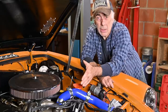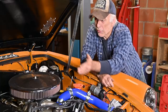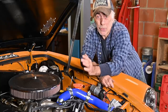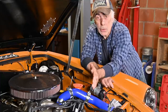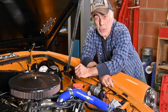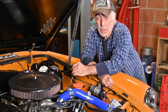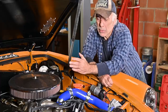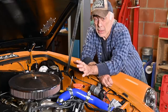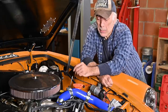This car has a relay for the fan and the cabling has been messed with by someone else, making it difficult to find. First, check that the fan fuse in the fuse box is intact — in my case it was good. I found the relay, and I'm going to check what's happening. After that we'll take things apart — remove the water pump to show you, take out the thermostat to check it, and replace all the cooling fluid.